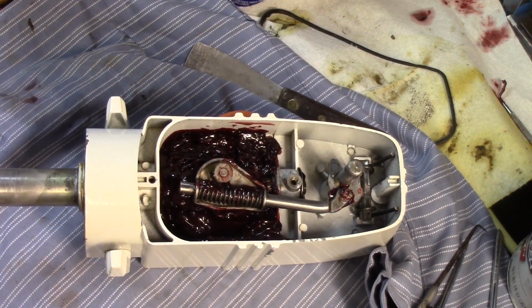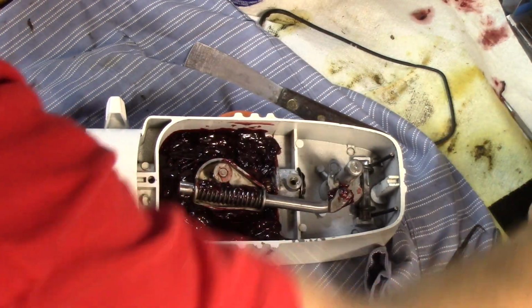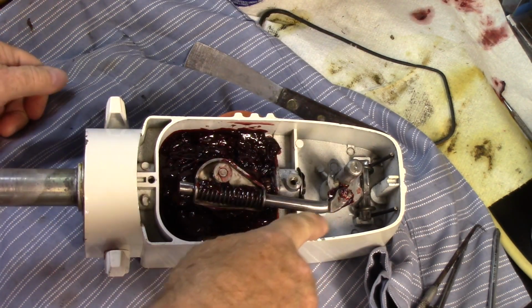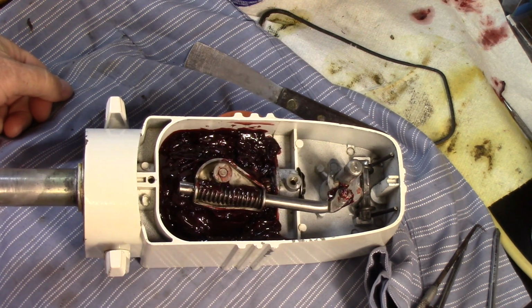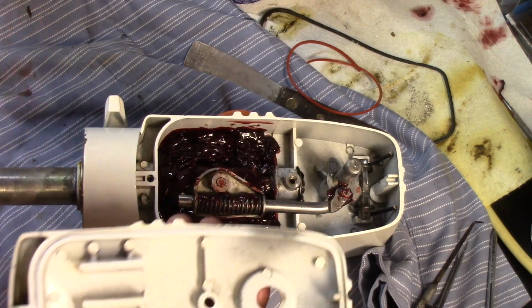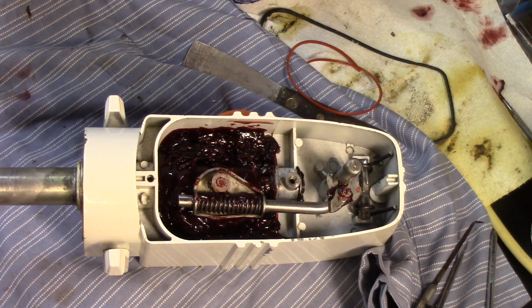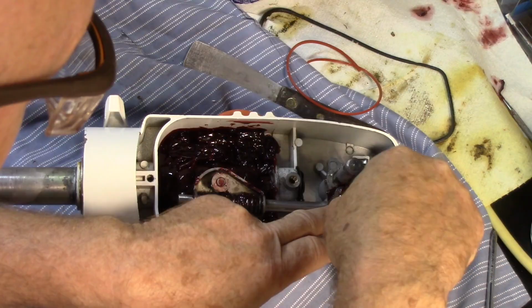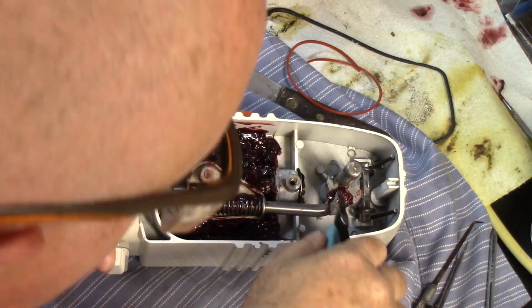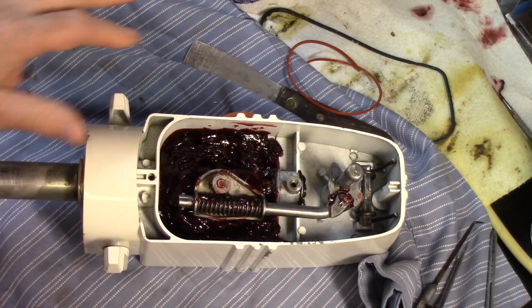Okay, as you guys can see, I got the transmission sort of back together again, all new grease in it. This is the heavy duty complex grease that I've been using. Had to go get a new cotter pin for this, which I haven't installed yet. So I'm just going to use a bead of silicone in the groove on this cover all the way around and call it good. So, you get a cotter pin in that, and we'll move forward. That should work. All right.